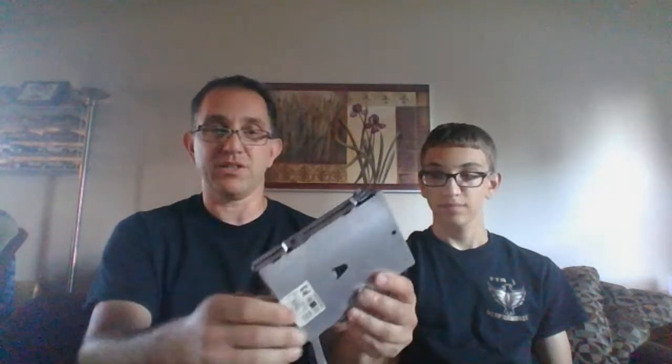In 1980, you have what a lot of people call the electronic spark control box, the ESC box, not your escape key. The electronic spark control box is located in the center console. 1980 has a black plastic panel underneath the ashtray covering the map pocket where it used to be. And this is what it looks like.